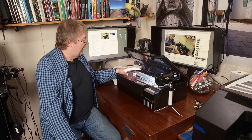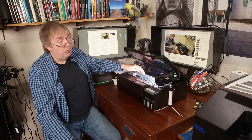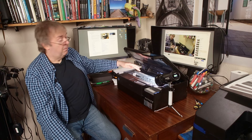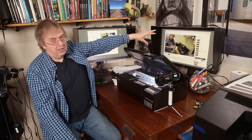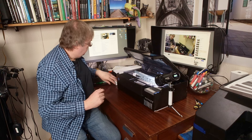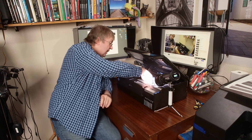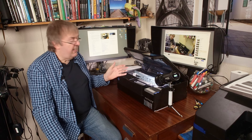Don't bother too much about cleaning elsewhere. In particular, there's a metal bar that runs along the back here — you'll notice it has a greasy deposit on it, which is a lubricant. That metal bar at the back of the printer is actually where the print head rolls along, so it needs lubrication. Don't touch it. Essentially, if you don't know what something is, leave it well alone. All you really need to do is check and clean the pad if needed — this kitchen towel is fine for doing it, and you should need to do no more than that.